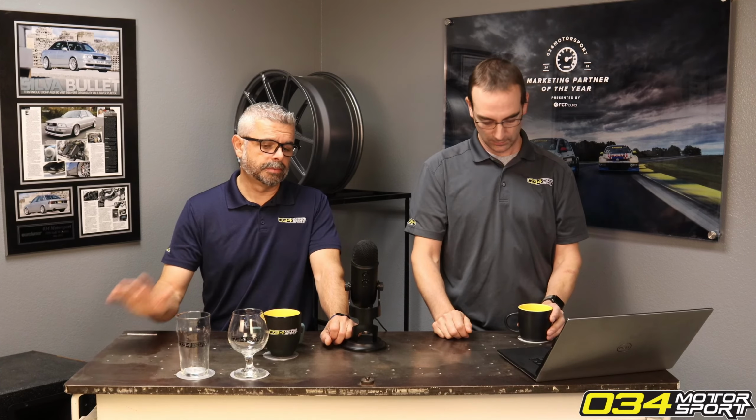Yeah, and the clutch in the DSG is designed to create more clamping force. That's not actually bad for it. No, it's designed to hold and withstand these types of clamping forces. What it's not designed for is slipping excessively, right? Excessive heat, excessive friction, things like that. Yep. So that's actually what hurts the transmission. A properly tuned file with the appropriate amount of clamping force to prevent slip is the most reliable.